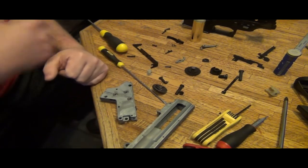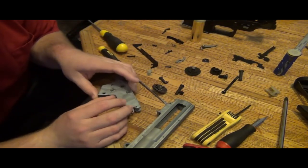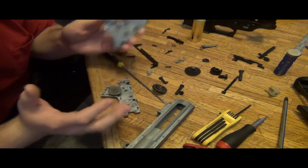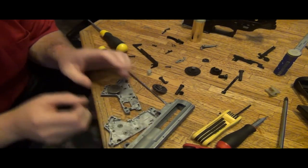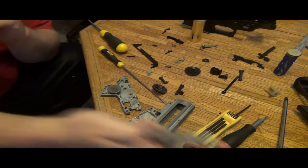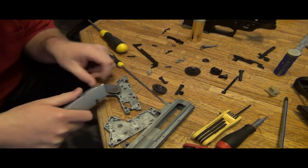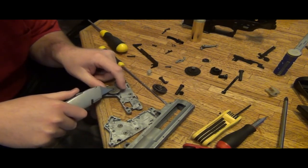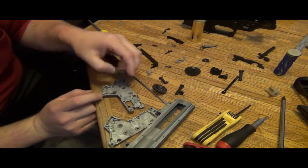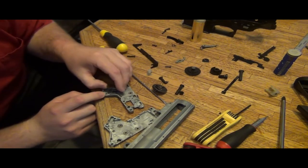Usually, I clean the gears and redo this whole process by hand, by myself, without relying on someone else's work or whatever's in the gearbox. But this time, because I've been practicing a lot of shimming with what's already there, basically to stay advanced with anything that would pop up shimming related, I've got some shims on the top and bottom here. It looks like two on the top and one on the bottom.